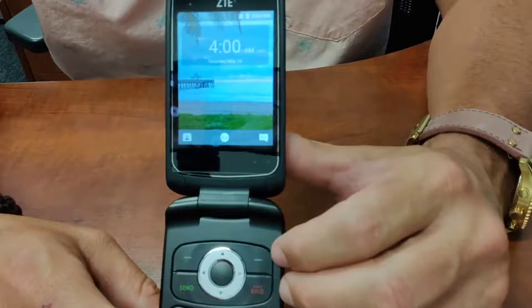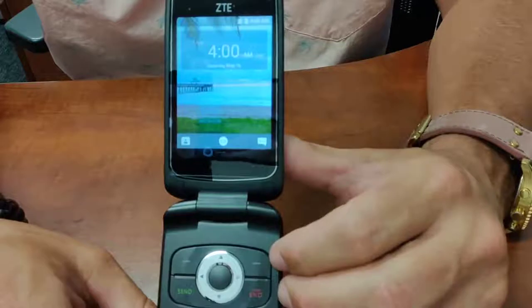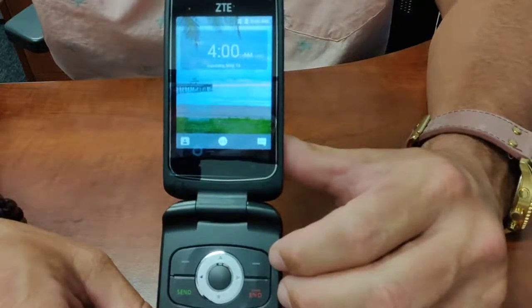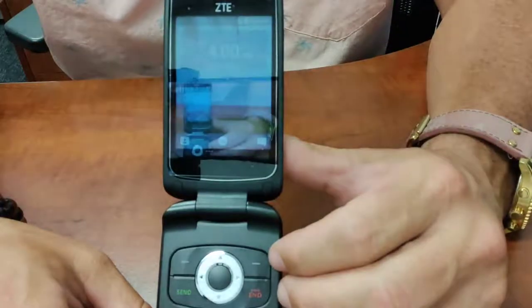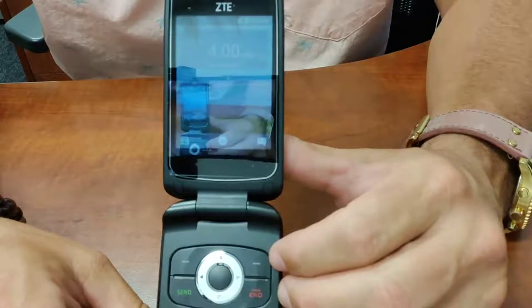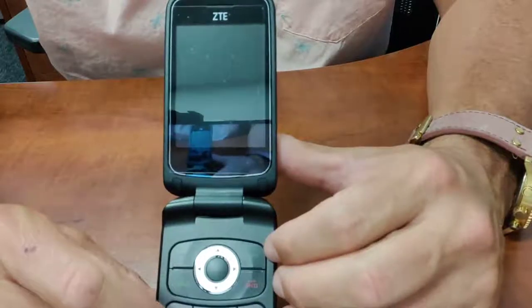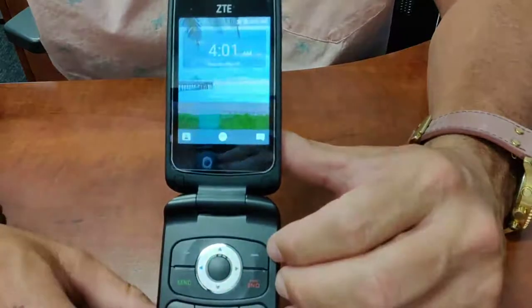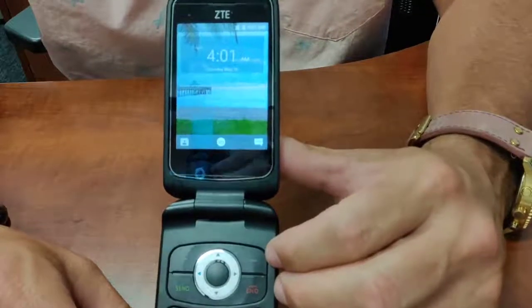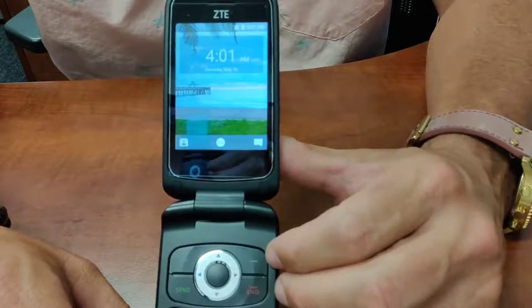You may have noticed that the phone went dark. The phones are designed to time out — you can just hit any key to wake the phone back up. That's a mechanism installed on the phone to help save the battery life. Anytime it's powering on that screen — which is a larger screen than a lot of flip phones and has a lot of color to it — you're using battery life, so the phone is set to power off. There are ways you can go into the menu settings and change that so it doesn't happen as quickly if you like, but that is there by design.